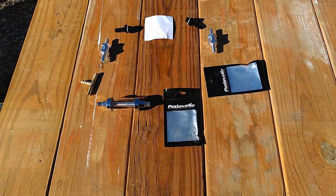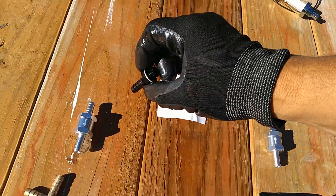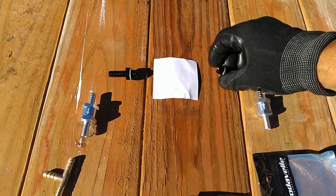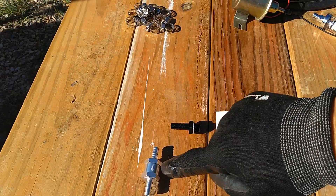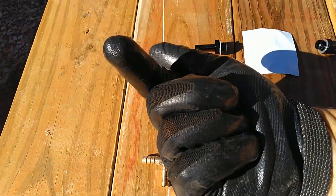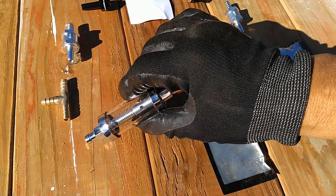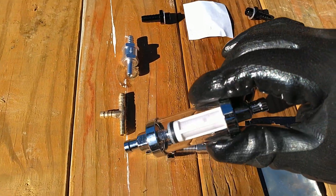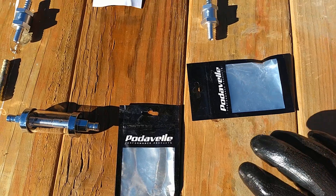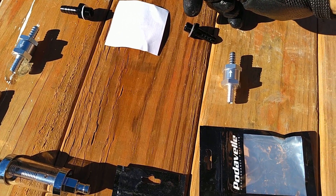Let's go through the theoretical of how this pneumatic oil pump should work. This white paper represents the engine crankcase. We're using 12mm by 1.5mm pitch barbed fittings with 5/16 hose. We'll have a barbed fitting coming out of the crankcase, going through a check valve, to a barbed tee with a section of hose blocked at the top — pointing straight up — that will just have an air pocket in it. This is a fuel filter with the element removed, and a glass fuel filter with the metal housing, which will serve as the oil cooler or oil filter. There's another check valve and another barbed 12mm by 1.5mm pitch fitting going back into the crankcase.